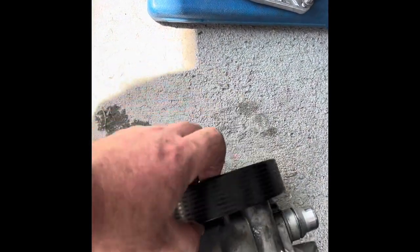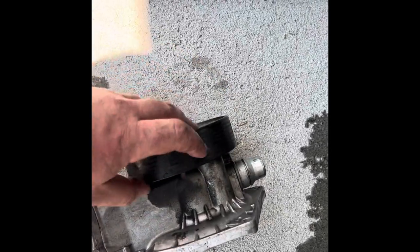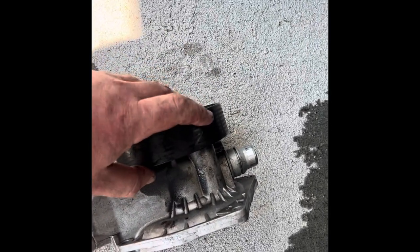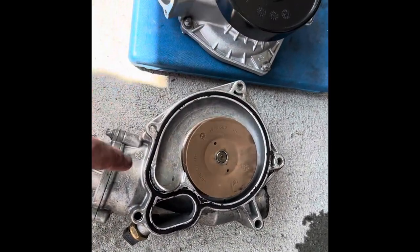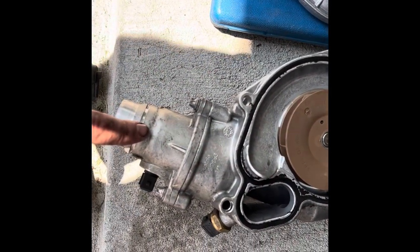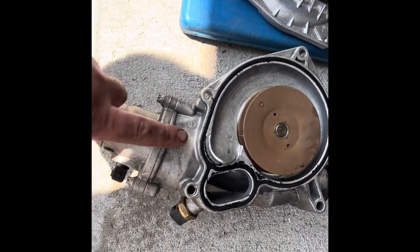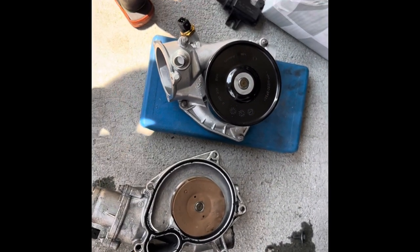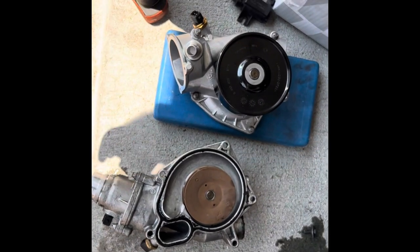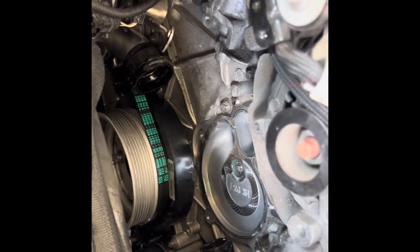Here we are — we've got two water pumps. When you spin the old one you get a clicking noise, so I'm pretty sure it would still last a while, but I'm glad I'm replacing it. I'm primarily replacing it because of the thermostat, because it is super hard to remove the thermostat without removing the water pump. So if you've got it off the car at my mileage, might as well just get it done. I'm going to clean up all the mating surfaces, swap out the AC belt, and start putting things together.